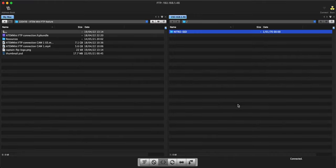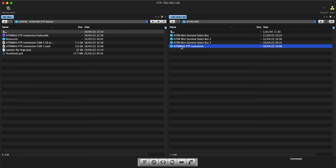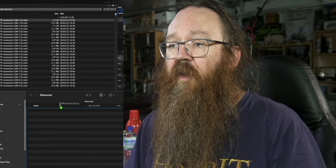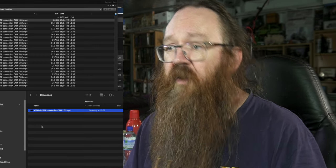Click OK and then the FTP software will connect to your ATEM Mini. It'll show you your hard drive's name in there — in this case mine's a Nitro SSD that I've got plugged in. Double click on the folder and it will open up the different recording projects the ATEM has created. You can see the video ISO files and each of the individual cameras. You can just copy this directly to your machine. On Mac you can drag a file from Captain FTP straight to a Finder window and it will download right away. Once downloaded you can ingest that into your edit software and create your video edit, all without having to plug or unplug any hard drives.